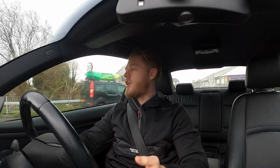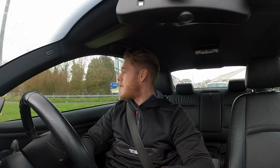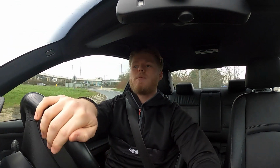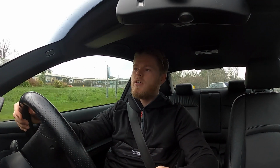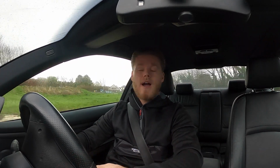just flows in normally. Basically, these flaps, I believe they're closed when driving at slow speeds, but as soon as you put your foot down and open it up a bit more, these swirl flaps open, causing this swirled air to come in, I'm pretty sure. But basically, after years of people having these on their cars, they've discovered that not only do the flaps build up carbon and soot, but they corrode slightly. And eventually, all the soot and carbon built up on the flaps can enter your engine.